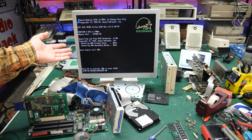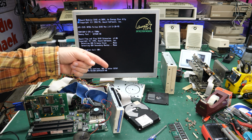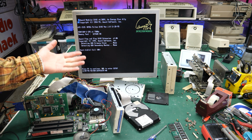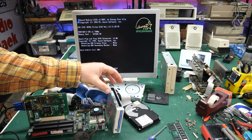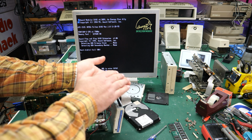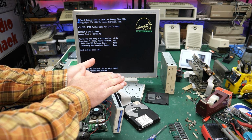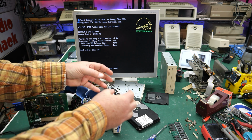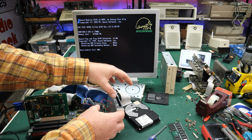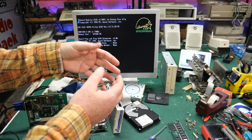The only thing that really works in this situation when you have those clicking heads is to find the exact same drive, and then you can try to emulate a clean room as much as possible. You can take the platters out, put them in the new drive. You have to do things with special tools where you separate the heads manually so the heads don't collapse on themselves, because that can cause damage. And then there is sometimes a way that you can take the old platters, put them in a working, electronically working drive and get your data back.